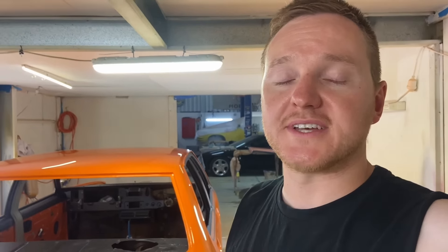The whole body shell on the outside has been blocked down up to 2,500 and it's only cut back with a number one cut. I use a 3M product which does a 1, a 2, and also a 3 which is super fine. Through those different grades you use a different pad as well on the dual action buff. Getting all the fine scratches out from the wet sanding, we'll cut the whole car with a rotary buff first with a lambswool — that removes 95 to 99% of the scratches or imperfections in the paint. Then we'll go ahead and use the yellow pad and a number one with the dual action buff. It remains nice and flat so you're not dipping the pad on the side and cutting out any paint to get a ripple effect. It keeps it nice and flat like an orbital sander while going into a rotary kind of motion, giving a better result. I'll talk you through and show you the polish I use.